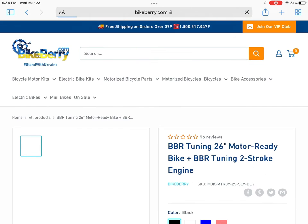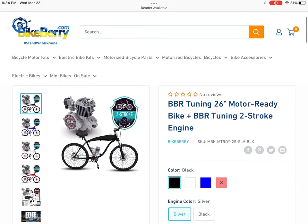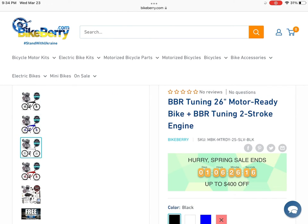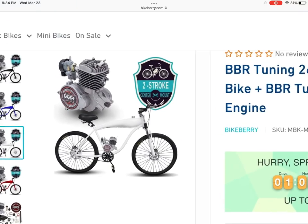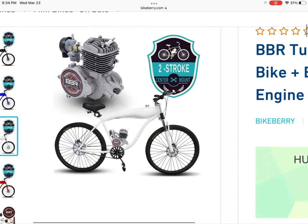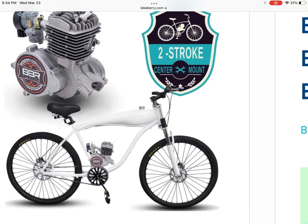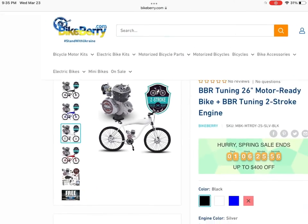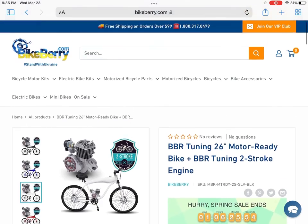There are some gas bike frames here. This is not the felt faker design — this is the standard gas bike frame. Not super sturdy, but it does have the built-in tank along with the built-in sprocket and everything. If you just want a frame that's going to be as easy to build as possible, this will be the one to choose. It has chain adjustments along with little 10mm nuts that allow you to pull the wheel back easier. It has disc brakes and front suspension — the front suspension on these bikes isn't known to be the best, but it's better than being a rigid fork.